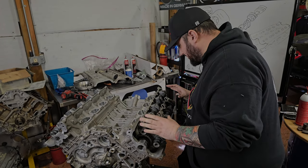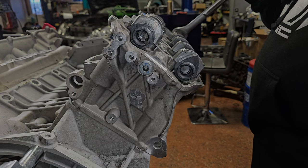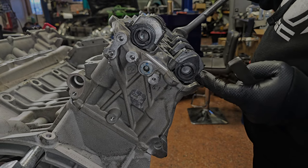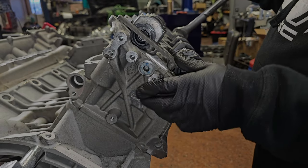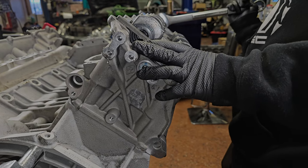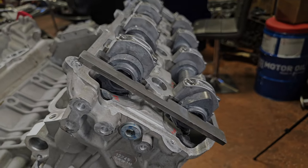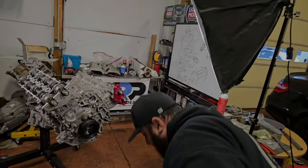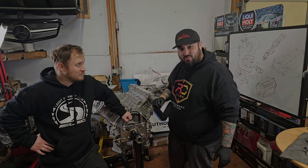All right guys, we're moving on to timing the engine. We'll show you from the back what needs to happen. You can see there's a half-moon shape - a big loop and a smaller loop - just half of that little circle on the camshaft. You want that slot to be even with the surfaces of the cylinder head so that the timing component can snap in there. You're going to have to turn the cam a little bit until it lines up and it will pop in. That is how it looks. This is where we're going to finish with this project - now that we have it buttoned up, we have some cellophane to wrap this up and prepare for shipping.